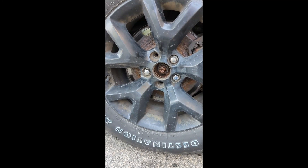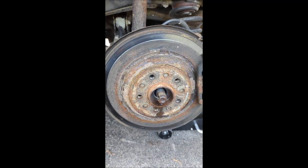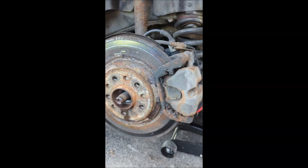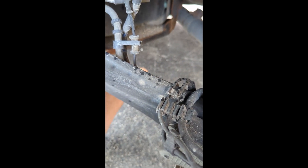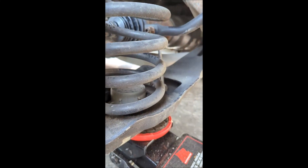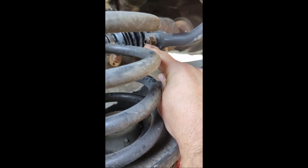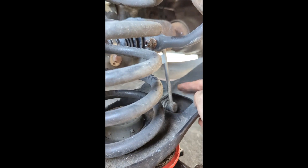Here's a little trick to get grip to take the bolt off the wheel bearing hub. First, remove the rotor and brake assembly — you can get all of these off back here and let your caliper sit to the side. Then take the rear control arm, or spring link: that bolt uses an allen key head to hold it in place while you loosen the nut off and take your control arm out.